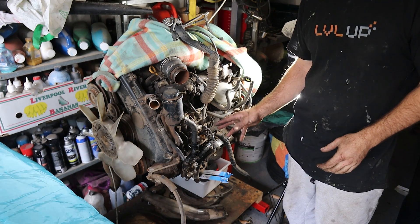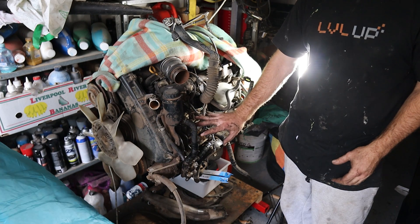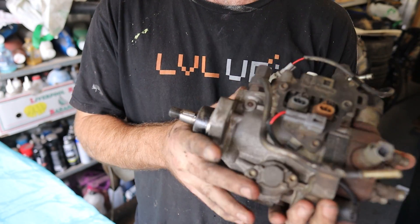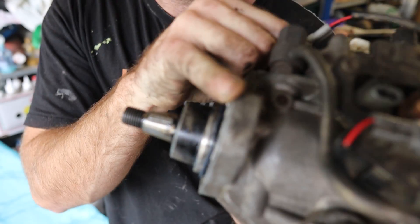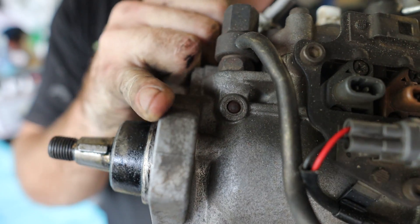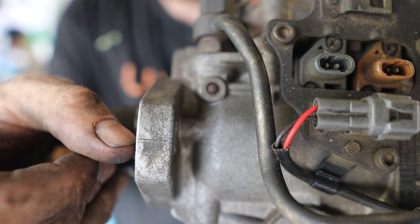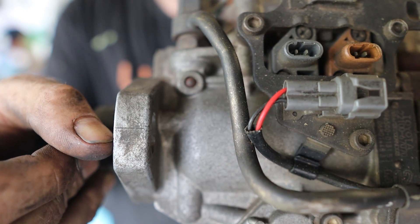This here is my spare engine just hiding in the corner, and it's great for demonstrations like this. We're going to be taking a closer look at the fuel pump and the case, the backside of the case here. Now, before we jump into that, it's important to note there is a mark here on the pump. You won't be able to see it when it's bolted to the engine all that well. But you can see halfway between this ear here, there is a line and we need to align that with something on the back of the timing case.